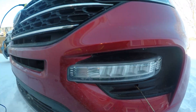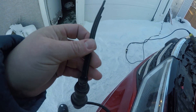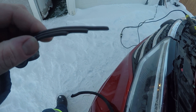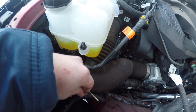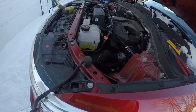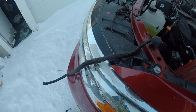I drilled the existing hole out to half-inch diameter just to make it bigger so the block heater cord fits through. I cut the block heater end off — there are three wires in there — and cut them at different lengths so when you re-solder them together you don't have as big of a bulge in your harness when you're done. I'm going to tape the harness to my clothes hanger that I fed through the hole and use that to pull the harness through. Then I'll solder everything together, wrap it all up nice and neat, and see how we're making out.